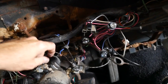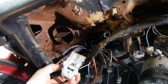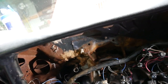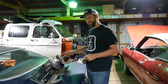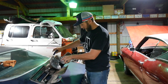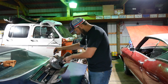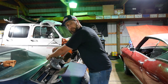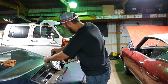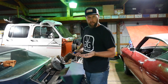Here's the fuel sending unit we're going to get into, here's the high beam — a lot of this is really accessible right now. Something to note: they do not want you hooking directly to the rheostat on the dimmer; they want you into the park lights for the gauge cluster. Also note that the back of the original panel labels all the wires for you right on it — light blue, dark blue, gray — telling you all the colors you'll need to tap into for turn signals, brake light, and so on. Keep this close by when putting the new one in, and hang on to your hardware because the instructions say you reuse a lot of the original hardware.